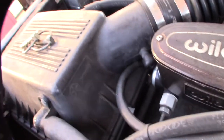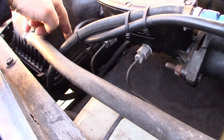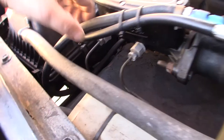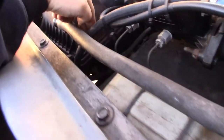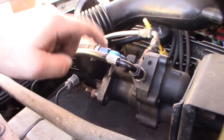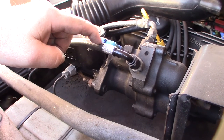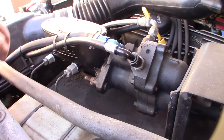What happens is it goes from the power steering pump, then the high pressure line feeds the power steering gear, and then there's another hose that feeds from the power steering gear back to the hydro boost. That's why this is the last leg — that's why you connect it at the hydro boost. The first priority is the power steering gear and the second priority is the brakes in this system.